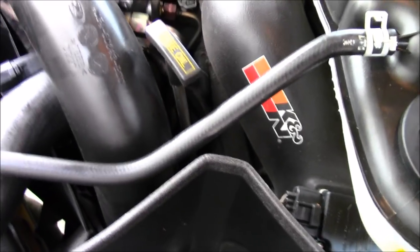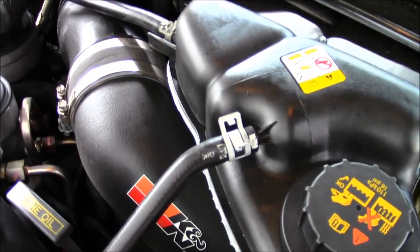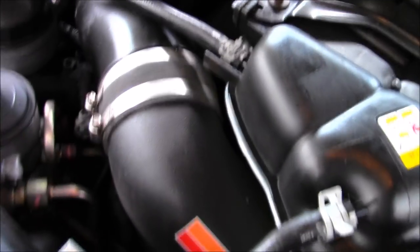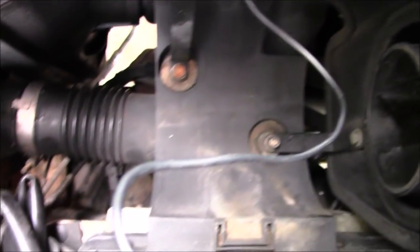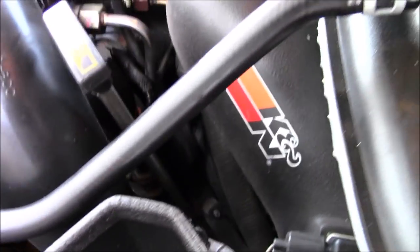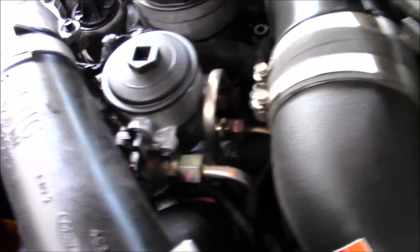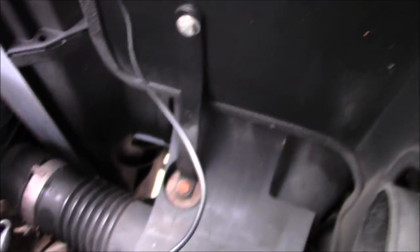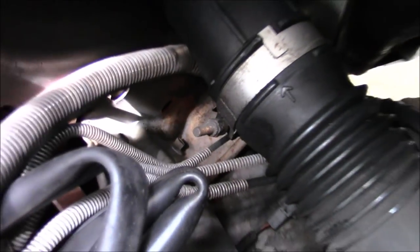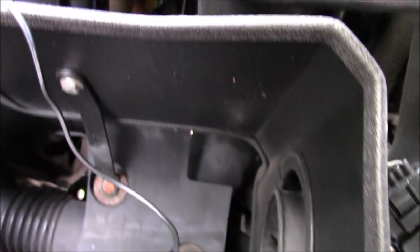Let's take you up in this bay. My installation is a little different because I have this K&N FIPK kit, which is basically a glorified cold air intake. It mounts right into the turbo and comes down underneath this air filter shield shroud. Here's the air filter I just pulled off — it wasn't even clamped on. This pipe is going to have to come out; it comes down to what I think is part of the turbo. Looks like this clamp loosens, and this one up here loosens too. Probably going to have to pull this box out to get that pipe out.